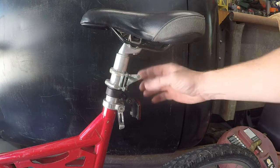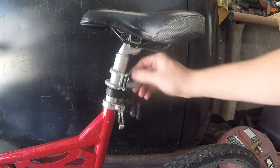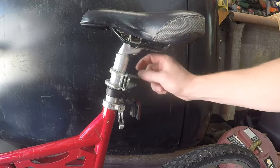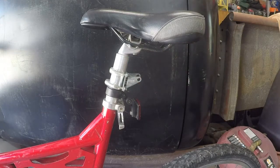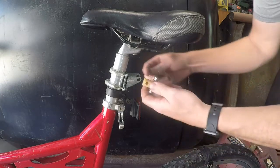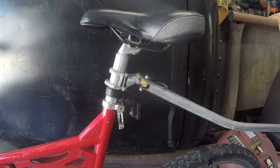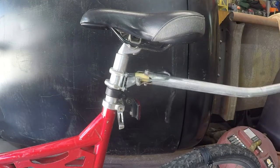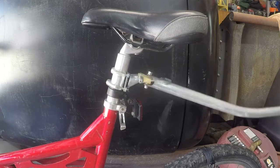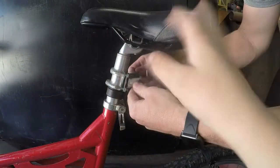Here is the seat post. What we've done here is taken a caster — the four screws bolted onto the bottom of something where the wheel can spin. We drilled out the axle for that wheel and pulled that wheel out so now it'll rotate all the way around. We've got this action and then we hook up this back arm that goes onto the canoe. Pin it right through here and lock it there. Now we've got up and down, it'll even swivel, and then we can rotate left and right — so we have full action right here. I don't know if that was over engineered or over complicated. I've seen a couple of easy solutions, but that is the way that we do it.